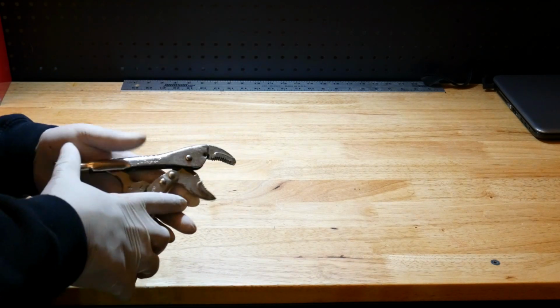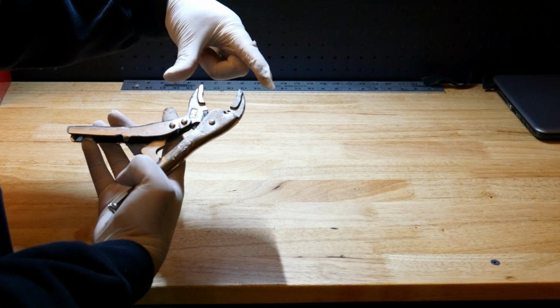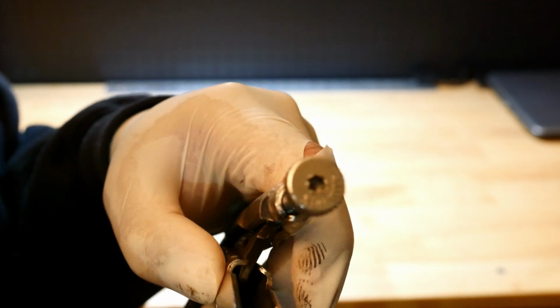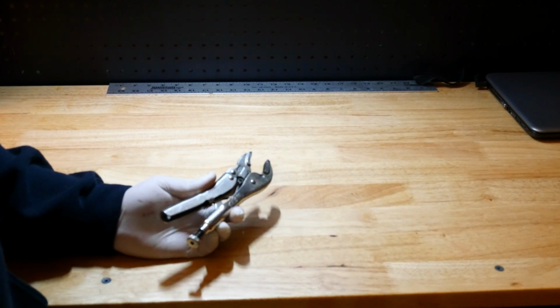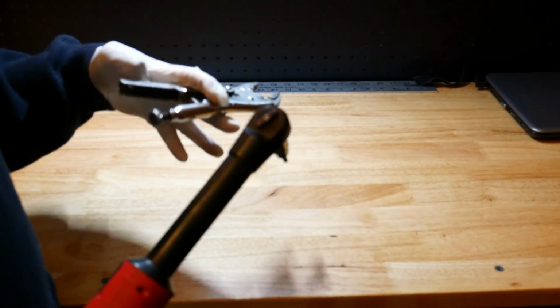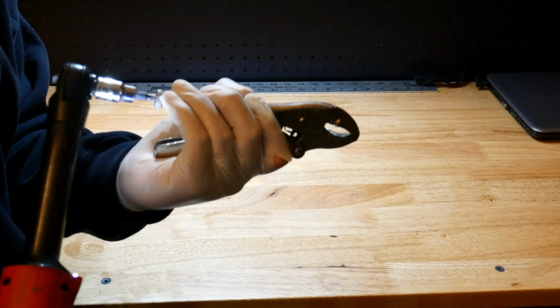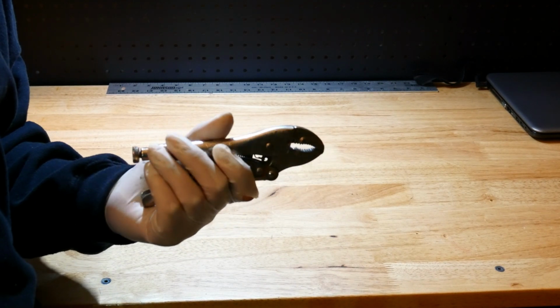Now, if you run into an issue where it's a really big spring clamp, the problem you have is that once you lock it, well, the vice grips are still open because the clamp is so large. So here's a tip for you. Almost every pair of vice grips will have a hex fitting on the back of the vice grips. So what you want to do to make it easy on you so you don't have to struggle, you could go ahead and clamp it loose just so that you got a bite on it, and then you grab your Allen socket and you can go ahead and run these vice grips down. Now you got a super tight grip on that spring clamp, and it's not letting go, and it didn't take you a whole lot of effort. You didn't exert a whole lot of your energy on one spring clamp, and you slide it down, and there you go.